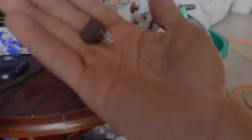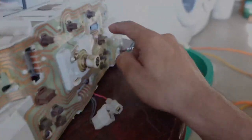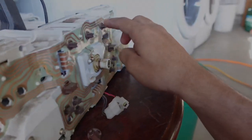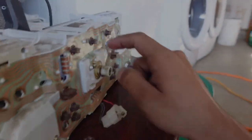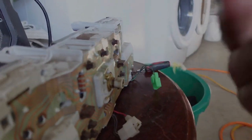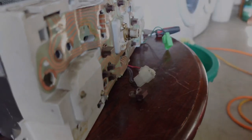You twist these out and get these little bulbs which are yellow and super dim. All the big ones you see are 194s, so if you want to do this, they're 194s. The little ones are a 74 bulb, which is also a T5. I'm only replacing the ones that light up the cluster body — the others are for your turn signals and those are bright enough already.